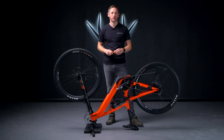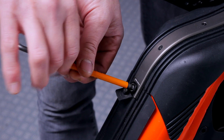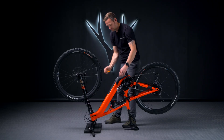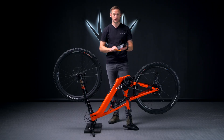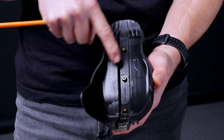Once you flip the bike over, you'll need a 5mm allen key. Remove the mud grommet from the top of the cap, then remove the 5mm bolt with the allen key. Remove the cap, which just slides off. If you've been on a muddy ride, you may find there will be dirt inside and also on the casing, so just give it a quick clean.